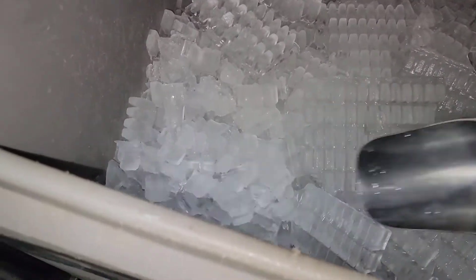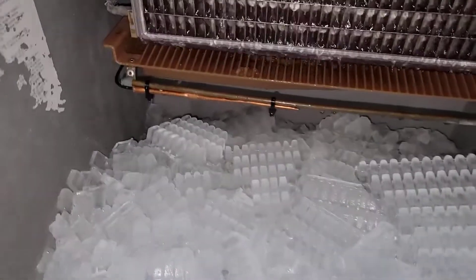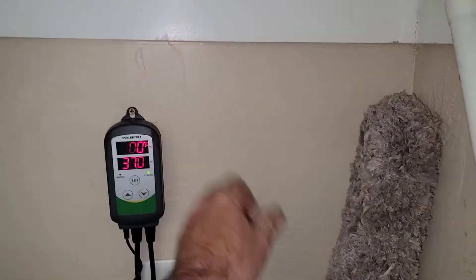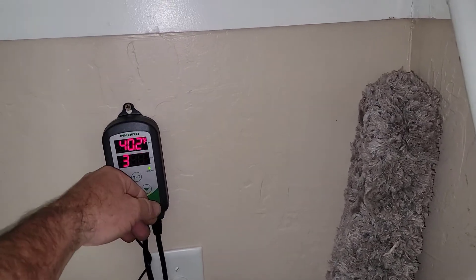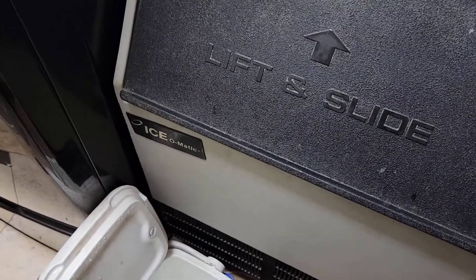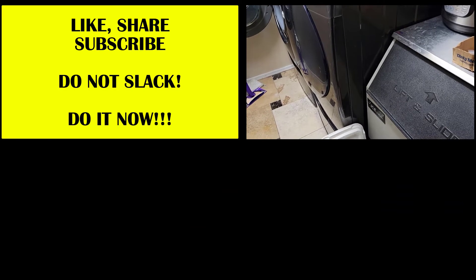It's been a day or so. Getting some ice in my chest and the ice seems to be bridging perfectly - just all comes apart nicely. I've got this electronic sensor shoved in there underneath and now it's not shutting off early. It seems like it's working pretty good and it doesn't feel hot. It's got a relay on a circuit board rated at 10 amps and this machine probably pulls about that. Anyway, I think it's good to go for now - Scotsman home edition back in operation. Like and subscribe and all that - stay tuned.